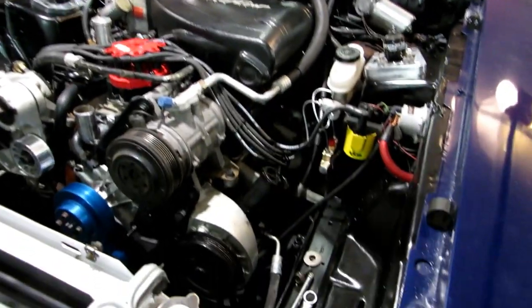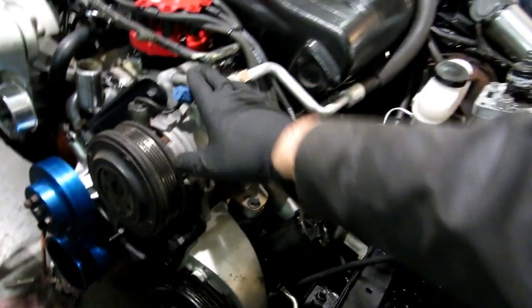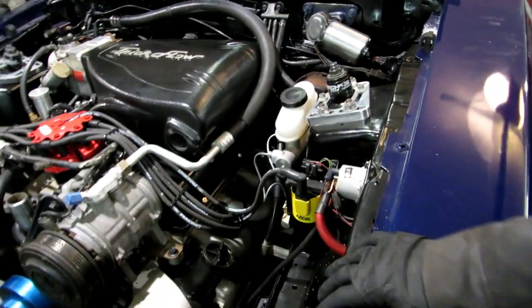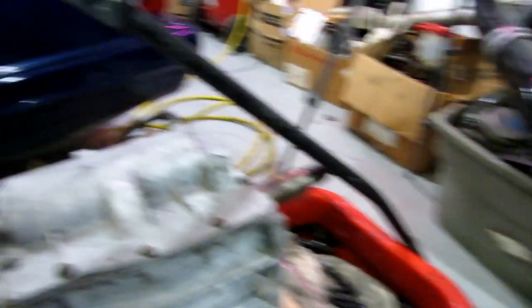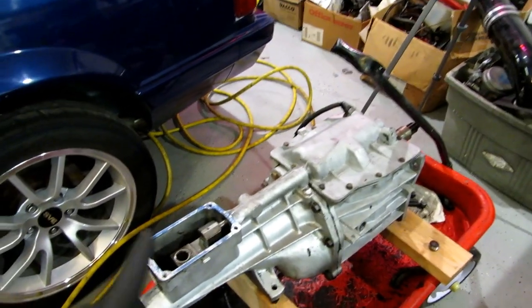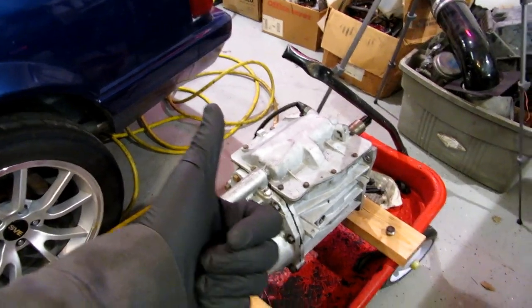The AC cable is plugged in and it's not draped across this area anymore - I extended it and ran it underneath the manifold and back under the fender where it's plugged in. It's not too noticeable, so it's not draping. In the meantime, let's get this transmission in. I've taken off the shifter, propped it up with some wood, and removed the drain plug. We're going to go ahead and fill this thing up until the fluid starts coming out, then put the shifter back on, lift the car back up, and see if we can't slide in the transmission tonight.